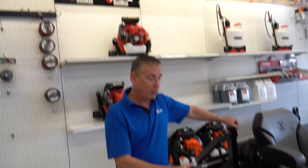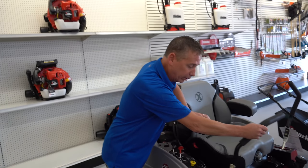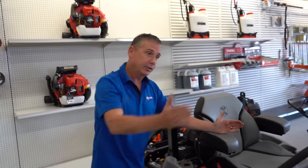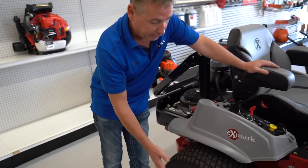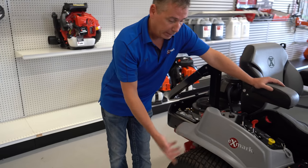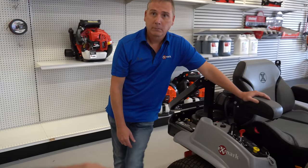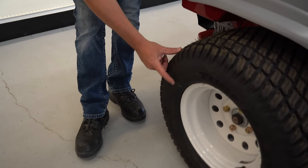When people have a tracking issue, the big thing about matching your tire sizes up is tracking — getting the machine to go straight. When I shove both sticks all the way forward and they're even, this machine tends to drift one way. That's the stagger of the rear tires. Just like I said, simple math — let's say this one is 73 inches in circumference. At the factory, we measure every one of them and match the stagger on the tires as close as we can. You take a tape measure all the way around the tire on both sides.